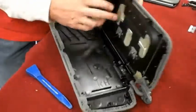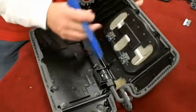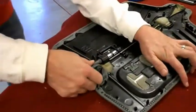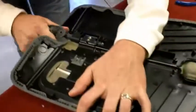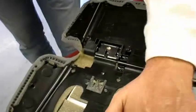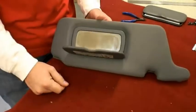You want to double check and make sure the mirror is not cracked. Now we're going to go ahead and remove all these plastic welds here so that we can snap out this mirror and slide out this pin, which you can just typically work back and forth. Set all that off to the side, remove the mirror, and this is almost ready for covering.